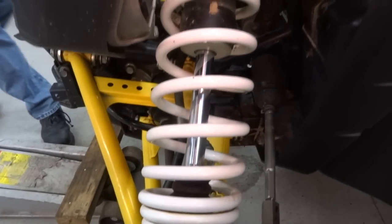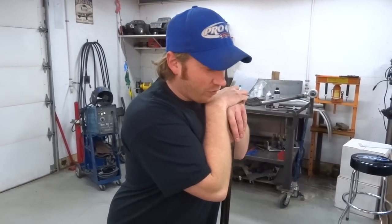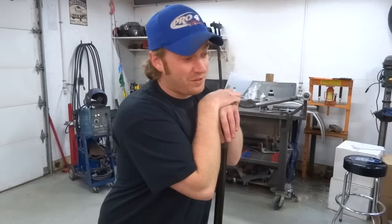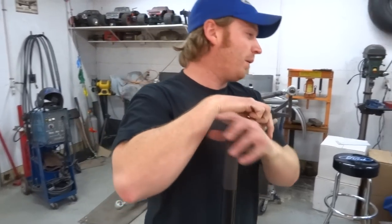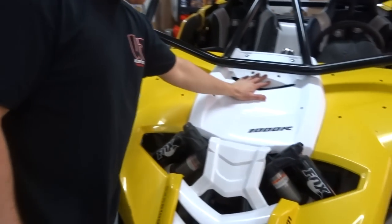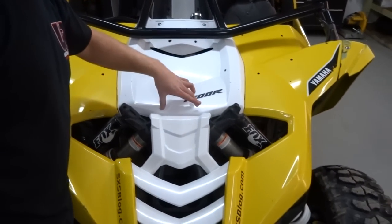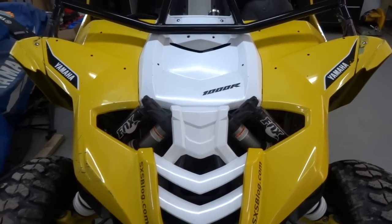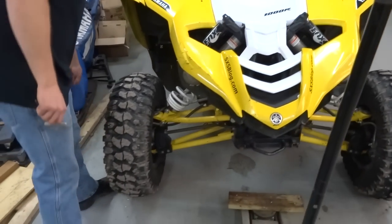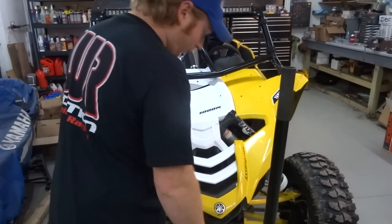Look at those truck springs, dude. What are those off of, a 97 Trailblazer? 350, I think. So I guess I'll admit, I haven't actually had the front shocks off of this thing yet, but I'm looking at it. How I think it's going to happen is I think we're going to take this hood off with these two screws. And then there's going to be a couple screws, a couple push pins under here, we can kind of pull this piece back so we can get to the upper bolt. Lower bolt's real easy to get. Looks like a 14 and a 17 - this should be easy.